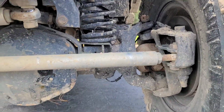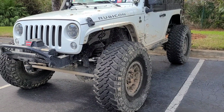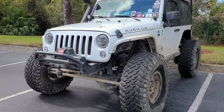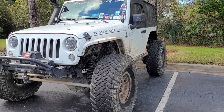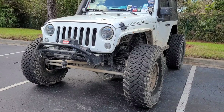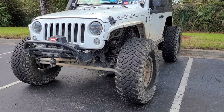So while I'm talking about that, my biggest mistake when I was doing this was not replacing all the wear items. Literally every week I was replacing a wear item because they're junkyard axles. So if you're going to do the swap, go ahead and replace all your wear items: unit bearings, wheel bearings, brakes, calipers. Just replace all of it. Save yourself the headache, because if you follow me on Instagram, you know I was wrenching on it a lot once I got it driving because it was all the old junkyard stuff not working right.